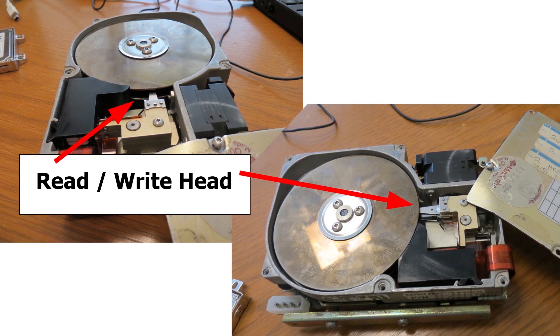People will use hard disks if maybe they've got a lot of video — say they're recording lots of lectures remotely. Or probably a better example is video surveillance, where you have a constant stream of video coming in and you want to store it all. Anything that requires a lot of data storage is going to be a lot cheaper with a hard disk or hard drive than with a solid state drive.